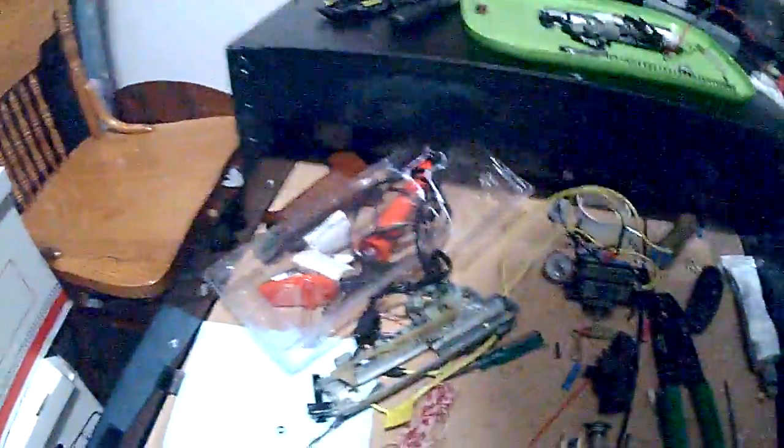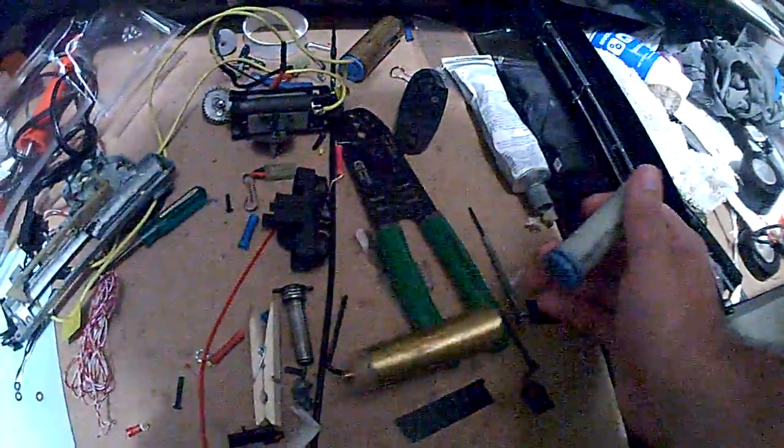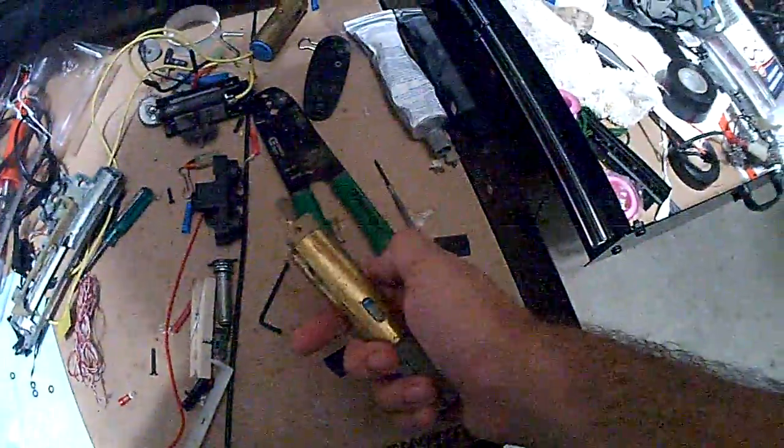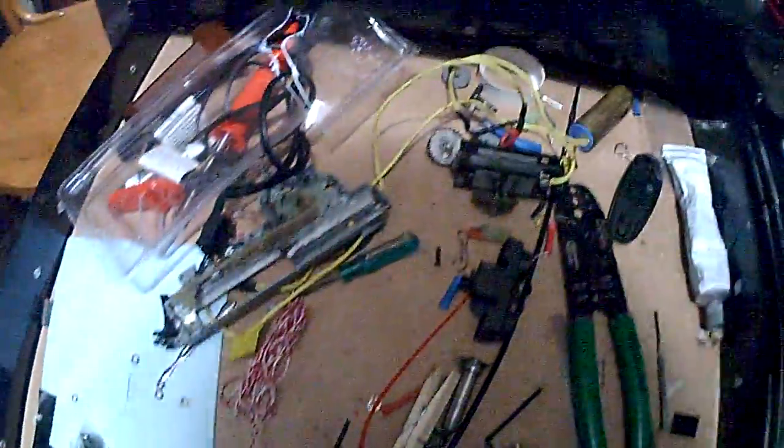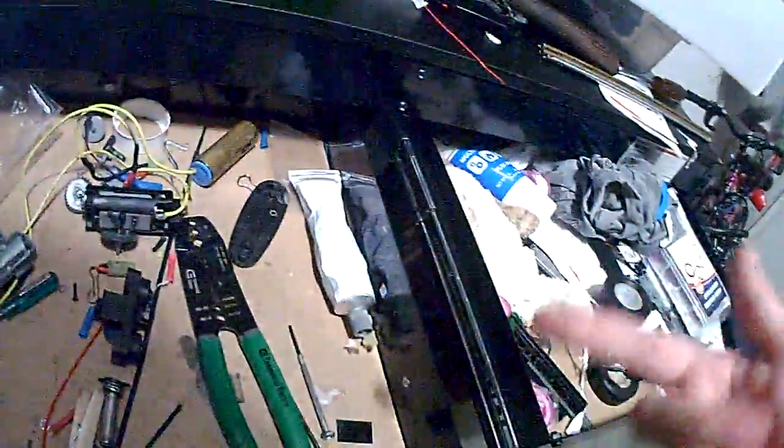But what we're supposed to do before that is: you take the o-ring — there's a little o-ring in here, just like there's an o-ring in here. You take it out and pull it and put it over the cylinder, which stretches it out. You're supposed to put a lighter on it, but I don't do that — I think that's too risky. So what I do is I just stick it on there and tug on it a little bit, then put it back with some dielectric grease.